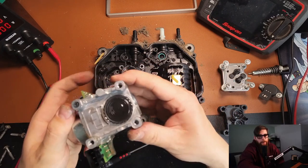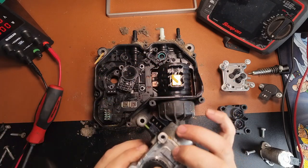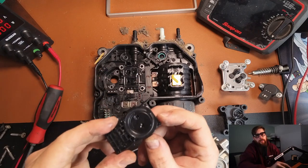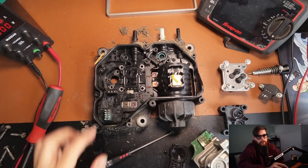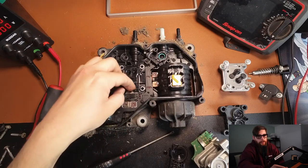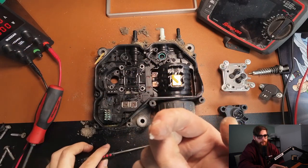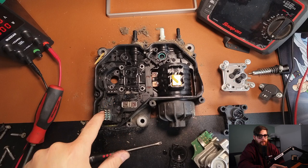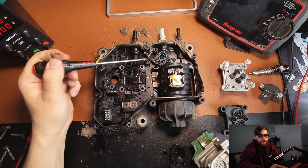I've also got AdBlue here and this is the fault with the unit as it was unable to maintain pressure. This membrane serves two purposes: one, it acts like a compressor head gasket with valves opening and closing to the ports, and two, it acts like a cylinder where it creates a void for the AdBlue to flow into. The cause of failure in this unit can be identified as wear and tear on this membrane, allowing a horizontal split to form and pass pressurised AdBlue into the casing, corroding the tracks and causing loss of pressure in the pump itself. Only thing left to do now is to cut out this metal track as it needs replacing, fit a full rebuild kit, and this will make the pump as good as new.